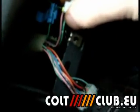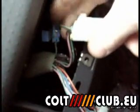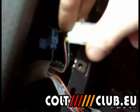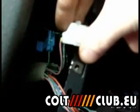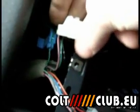So I'll just put a little scotch block into that — you can just about see the blue scotch block there. Basically you just put one wire, a standard green wire, in one side of it, and put the wire you want to connect into the other side of the blue clip. In the middle of the blue clip there's a bit of metal; you just push that bit of metal down, which creates a connection between the two wires, enabling you to splice into it.